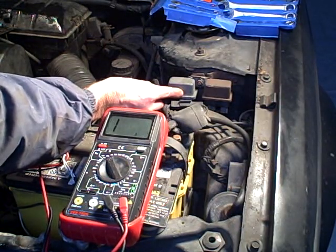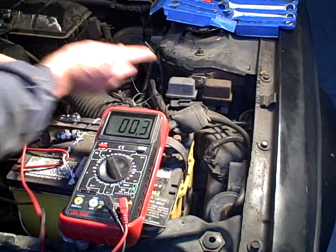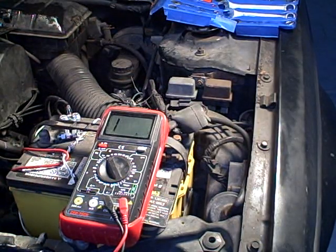I'm going to get a good contact here. There we go, 0.3. Because metal is all very conductive — unless it's intentionally there for resistance — going through steel over short distances, you essentially have no resistance at all. You're just seeing the resistance of the wires in the probe. I'm Morris Rosenthal for ifitjams.com. Stop by our website and see some more troubleshooting information.